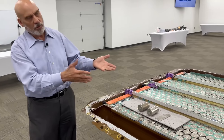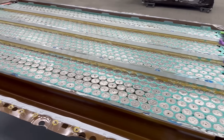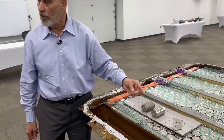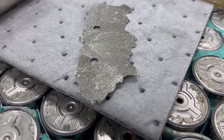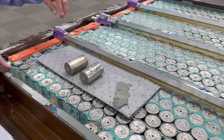This is the battery — the battery farm. This is upside down, so we're looking at the ground here. We'd taken the cover off last time you were here. And if you remember, the batteries were covered with this kind of mica that covers all the cells. We've been dissecting the battery further. We've got essentially all this removed to where we can start to bring the cells out, which is not easy. Those cells are not supposed to come out of there. They're packed in solid. You remember when we looked at the fact that they inject this foam in six points around each and every one of these — this sort of teal-colored foam.